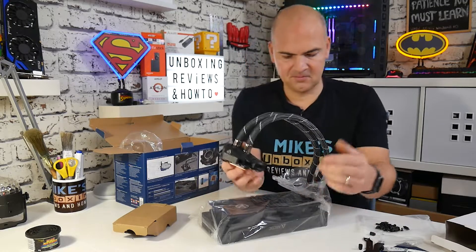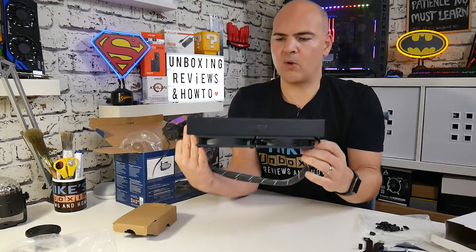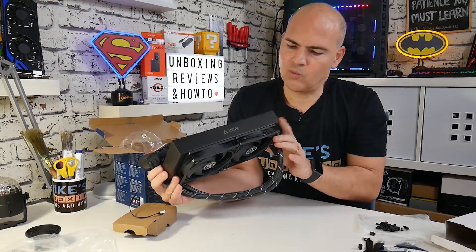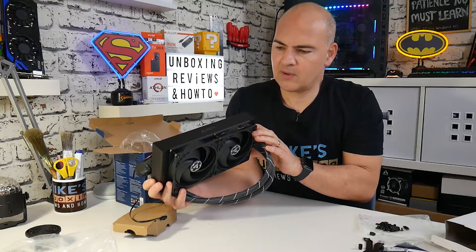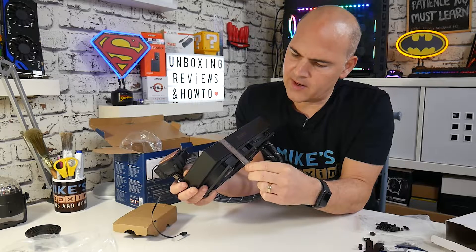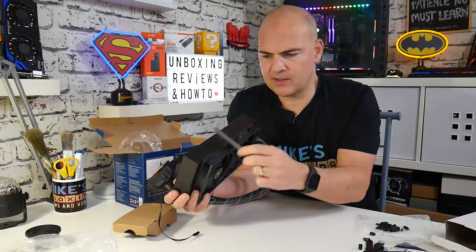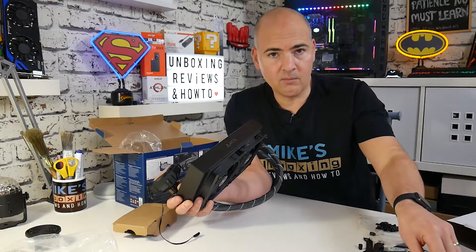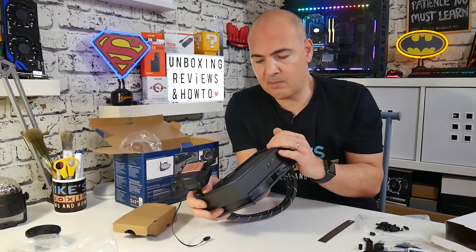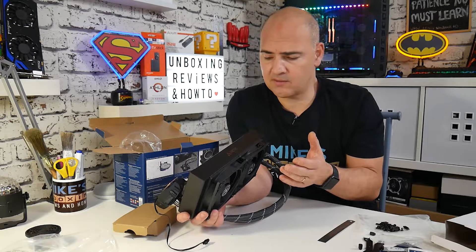Let's have a look at the actual radiator itself and the fans. The entire weight of this is just over 1.1 kilos for the entire unit, so it is going to add a little bit of weight to your build. These are your normal 25mm fans, and the depth of the radiator itself is about 37-38mm, so it is a little bit thicker than usual — normally we're used to seeing 25mm, the same width as the fan. With that, we've got obviously more thermal mass because there's more metal used, and the channels that the water runs through are going to be bigger, so you've got a better cooling solution. Thicker radiators were very popular in the early days of water cooling because they did offer that much extra thermal mass and reduced temperatures accordingly.